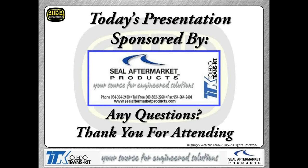There are 2 turbine revolution sensors, and you can see the early Type 1 on the top, and obviously the one on the bottom is the Type 2 system. Both of them, the turbine sensor 1, is monitoring the front sun gear shell, and the turbine sensor 2 is monitoring the input housing front planetary shell.